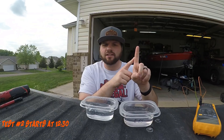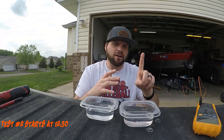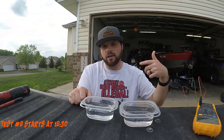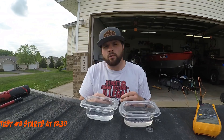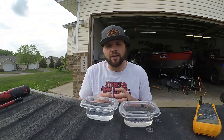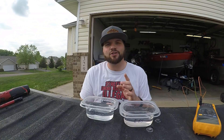And I think this does signify the temperature probe that's in the bottom of the intake manifold — it is getting moist air. Some people are saying I need to move that probe into the runners, which I'm actually going to do a test on. I don't believe that under full throttle it's getting soaked to the point where it's measuring just the fuel. I think it's the moist air. But I do think that it's a wet bulb reading, so it's going to read cooler.